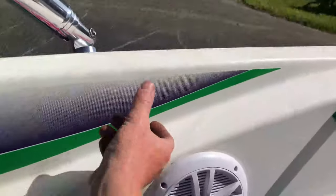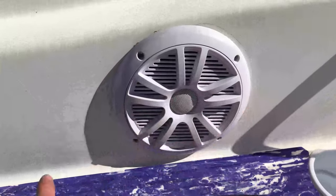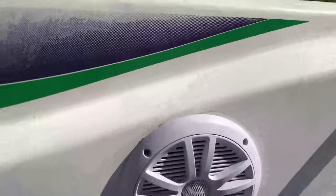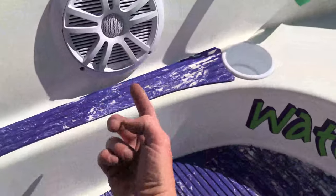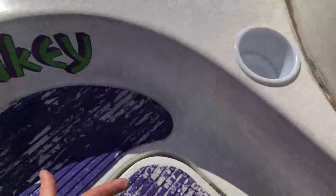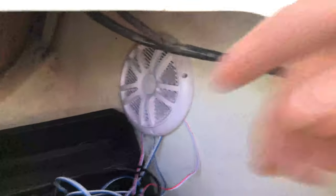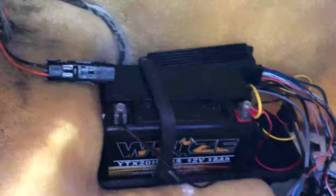In order to get the backer board and the nut on this side, I cut a hole right here. I placed the speaker on here — it was a five and a half inch hole — and these are the Boss speakers; I'll put the number in the link. I ran the wire through here, came under here, was able to reach up through here. I put it inside the steering column — you can see there's where I made that hole to make this other mount — so I went through that hole, and that's where I pull my speakers. Got the extra battery and my amp just sitting behind here.